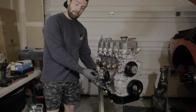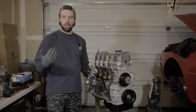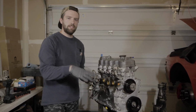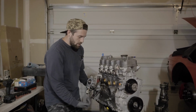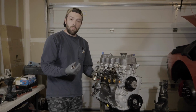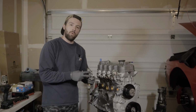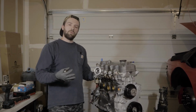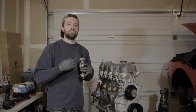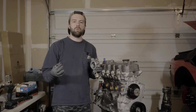Attach it to this block, and oil's gonna come through from the oil pump on startup and under normal operating conditions. It's just chain driven in here, can't see that, just trust me. Pressurized oil comes on in, into the filter, gets filtered through the oil filter, and then goes through these different chambers out to the oil cooler. Now, an oil cooler is a really wise idea, especially if you are turbocharged, supercharged, or just generating more heat than the stereotypical naturally aspirated small horsepower motor.